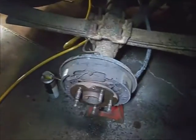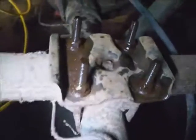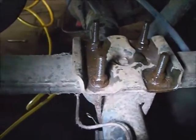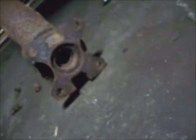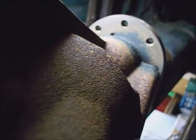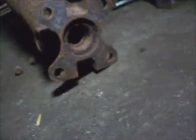Not to the point of spreading the shoes. Got the U-bolts wire brushed up and sprayed with penetrating oil - they'll come off a lot better if you knock the scale off the studs, or put new ones in. The driveshaft yoke is off the differential flange. It's beneficial to leave one bolt halfway in while you pry the flange off, or just tap on it with a hammer. There are holes right under the edge of the flange - stick something in there and pop it loose, and let that bolt catch it so it doesn't hit you in the head.